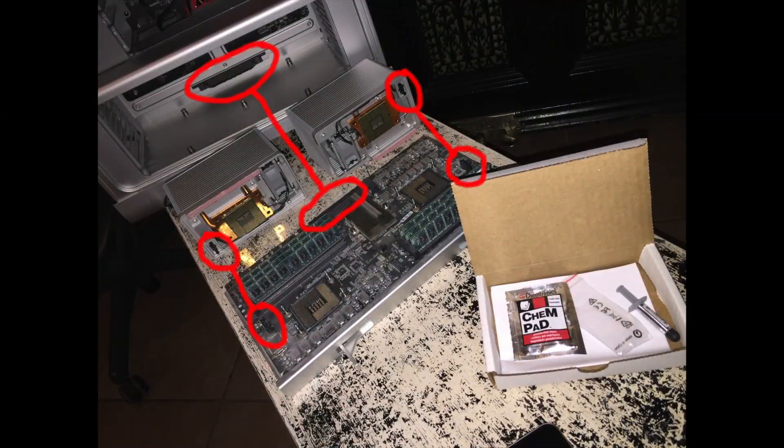Putting it back together, you're going to match the electrical connectors on the heatsinks onto the daughterboard, set them, go straight on. Tighten the bolts about nine turns until you feel them lock in. Then you're going to slide the daughterboard in into those connectors — it fits snug, can't mess this one up. The little flaps at the end on the daughterboard are what lock it in.